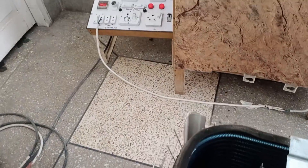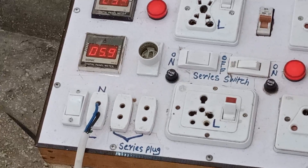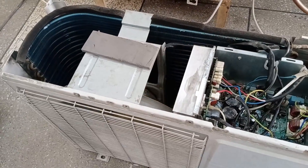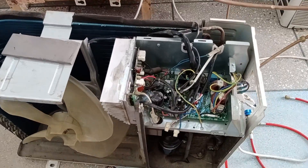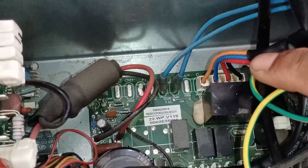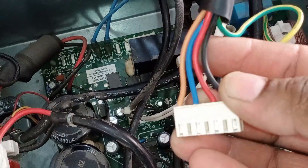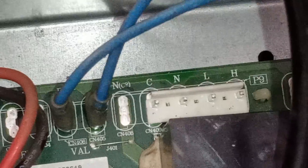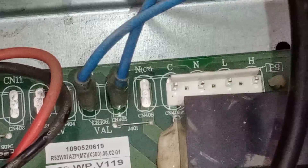I will remove the top cover. The compressor is working right now. The amperes are 5.6 as shown on the meter, and they are increasing. I can see the fan motor is still working. I will now have to check whether the fault is in the circuit board or the fan motor is faulty. This fan is powered by AC electricity — it's not a DC fan motor. Let me explain the possible faults in the circuit board. First, if there is an air gap between the IPM and its heat sink, it will heat up the IPM. This is the connector of the fan motor on the circuit board — it has four wires, indicating this fan has two speeds. The connector is labeled C, N, L, and H, which means common, neutral, low, and high speed.